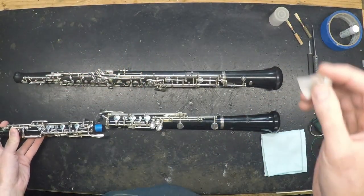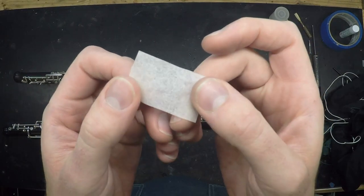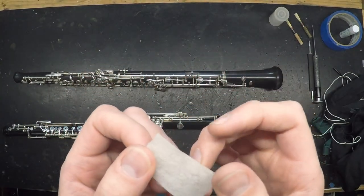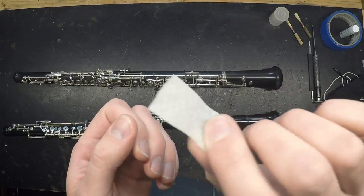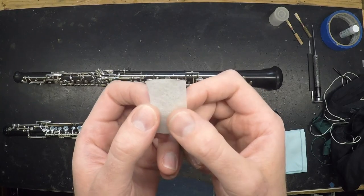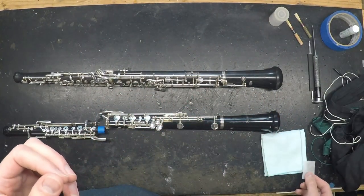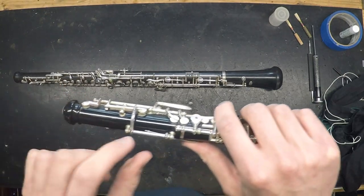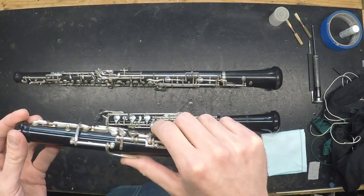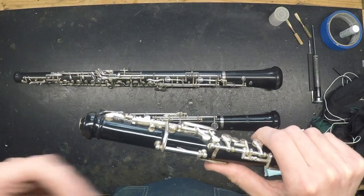You can also use something similar in consistency to a dryer sheet. This works really well because the woven texture seems to collect deposits from the surface of the pad and the vent. This was given to me by another tech, Jan Bunata from Toronto — I believe it's a non-woven polyester sheet, but I'm not sure, and I'll post that in the description below. It's not a dryer sheet, so don't use a dryer sheet in that situation. The only way to permanently fix a sticky pad is to replace it and to remove and clean the vent — the metal part that the pad contacts — and that should be done by a technician.